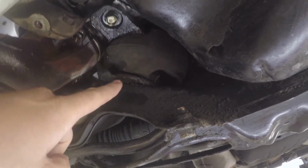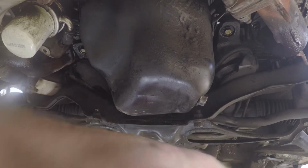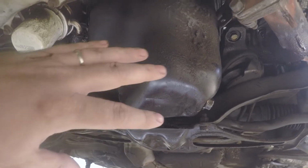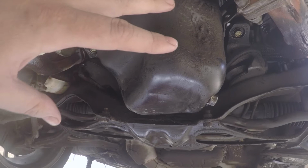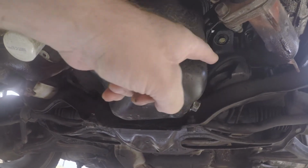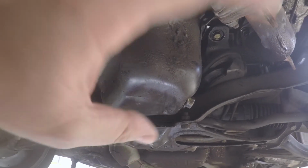These are shot. So whenever I turn the car on, the motor just does this. It rocks and clunks and smashes up against the subframe. So this is something that, yes, it's not a mechanical failure in the motor, but you do not want to drive around with motor mounts that look like that. You will destroy your car. So I have to change these out.